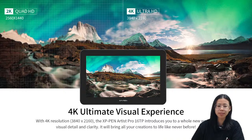So the Artist Pro 16TP is now with the 4K ultra high definition screen. The higher the resolution, the better the image quality. The resolution of a UHD screen is 3840 by 2160 pixels. That's 8.3 million pixels overall, which is 4 times higher than HD resolution and 2 times higher than a QHD display. So it displays 2 times more pixels than the QHD screen, and so it brings a clear and more natural image.